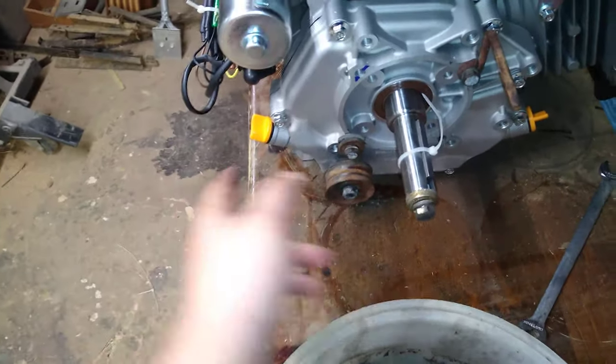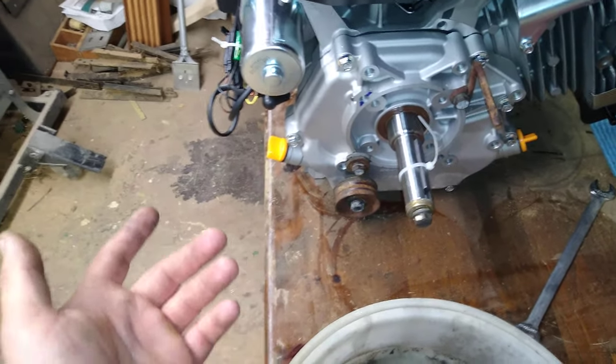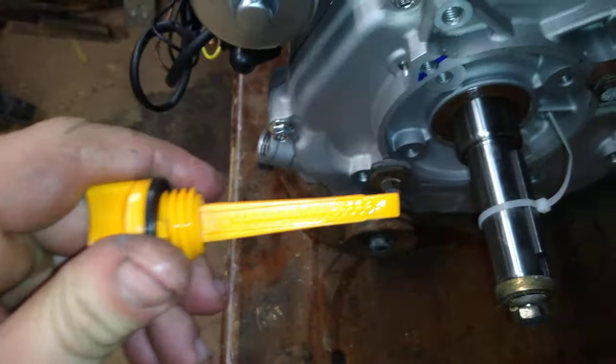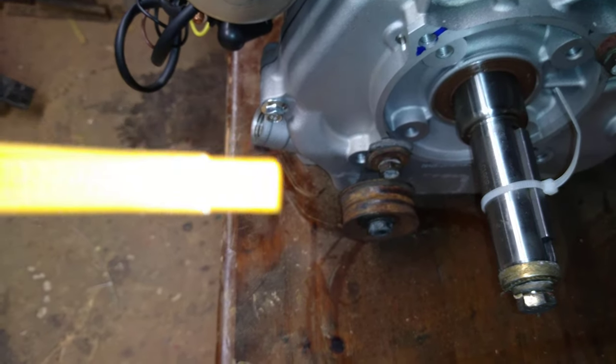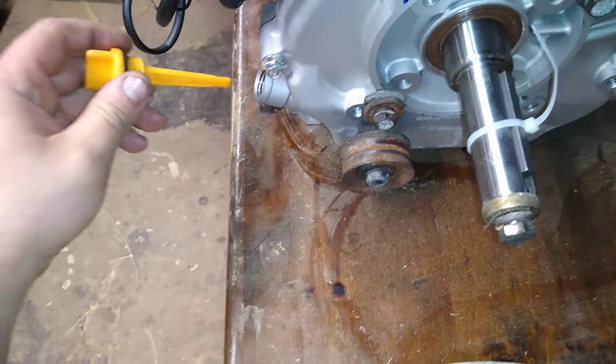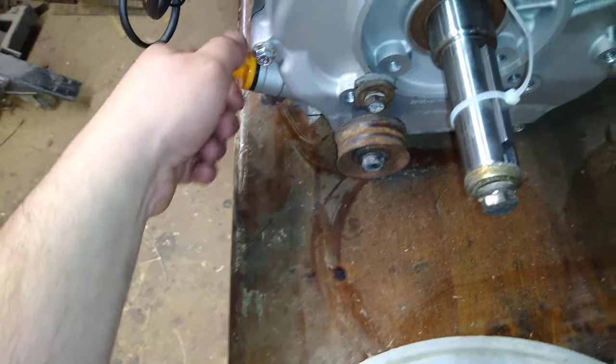This engine is also very versatile — it has two oil fill plugs, one on each side, so depending on your application you don't have to sacrifice accessibility. It comes slightly pre-filled down to the low mark, so you have to fill it yourself. The store said they take returns on the motor, but not if it's full of oil or gasoline, so be aware of that.